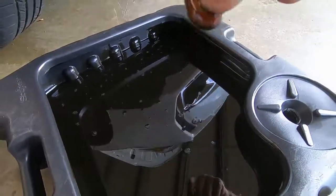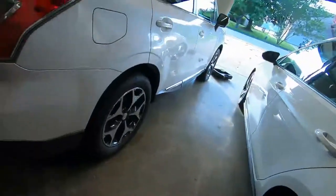This is a 6,500-mile oil change. It still has some clarity to it — not too bad, you can see through it, it's not black. To be honest, if I were to do a Blackstone test I could probably run this to 10,000 miles, but I don't like to push it. I already waited an extra thousand miles from when I was originally going to do the oil. It's probably a 10,000-interval oil for this oil. We're at almost 40,000 miles on this car — no oil drips anywhere on the ground, which is good.